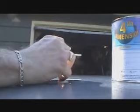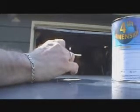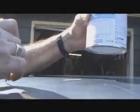Alrighty then, let's see what we can see here. I actually have some leftover paint that was reduced, came out of my gun, and I'm just going to try this experiment. I'm going to daub in where the early bugs got into my base coat, because when I sand it down there's a little white dot there that goes down to the primer. So I thought, well, this stuff should dry immediately in this hot sun, so I'm just going to do that. I'm going to daub in all these little white spots just for the kicks, see if I can at least get it down in there. What can it hurt, right? Can't hurt anything. It might buff back out, I don't know. This is my experiment and you get to watch it.